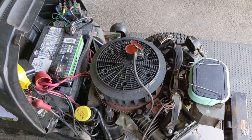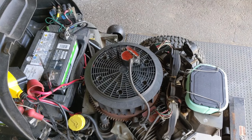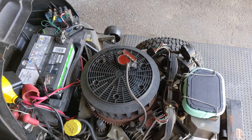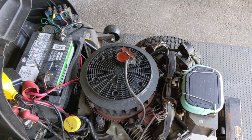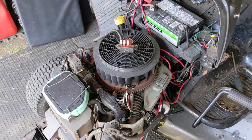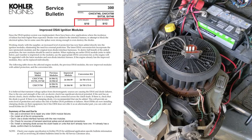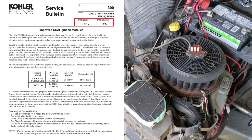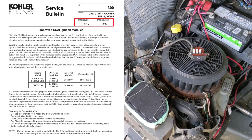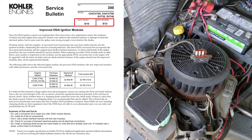This is very similar to vehicles — if you engage your AC compressor or turn on air conditioning, there's going to be an electrical surge because the car's electrical system is put under more load. Manufacturers like Diode Dynamics, if you've watched my LED videos, are installing diodes directly into their LED bulbs to prevent failure due to those electrical surges. This issue happened to Kohler engines of both the Courage and Command series throughout a whole bunch of different model numbers, as shown in the original service bulletin from 2010, revised in 2012 when they came out with new ignition modules with diodes installed.